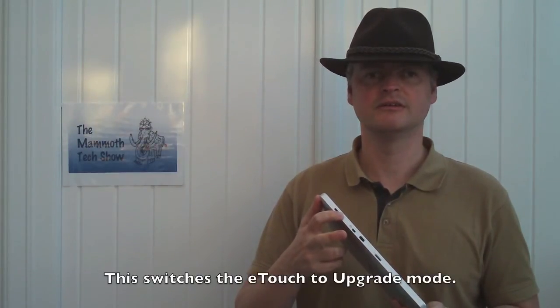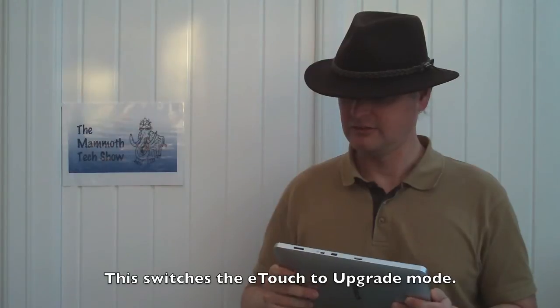Once you're in a position to be able to upgrade to Android 2.2, download the update from the support pages. Then unpack it onto the microSD card. You then insert the card back into its little slot. Again, switch it on with the left button pressed down, and the upgrade procedure will begin.